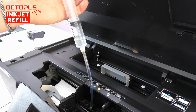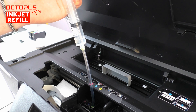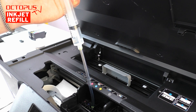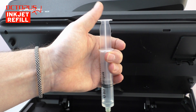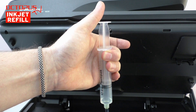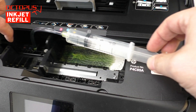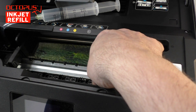Now we start to clean the printer's yellow color. Press the plunger on the syringe carefully in and then release it — you can see that the plunger slides out again by itself. The cleaning is essentially a kind of gentle pumping of the syringe. The plunger slides out by itself because there is air inside the syringe; by pressing the plunger, this air is compressed and gentle pressure towards the nozzles in the print head is built up. This approach avoids using brute force to clean the ink system. You can tell the color path is clear from ink port to the nozzles again when the cleaner fluid level drops in the syringe, and when beside the print head compartment in the protection padding the mix of cleaner and dissolved ink appears.